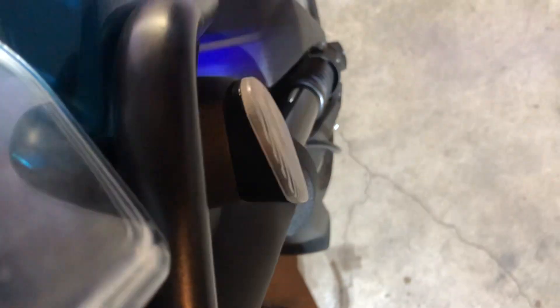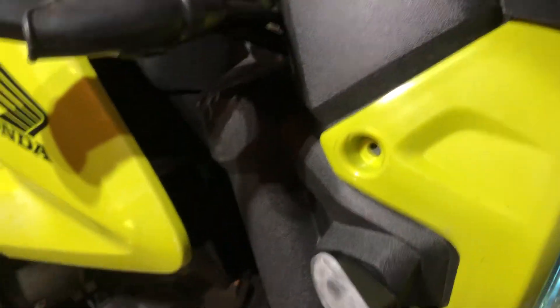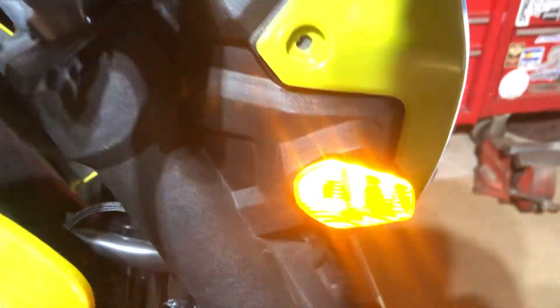I just switched a blue and white wire and a green and yellow wire underneath — you literally just swap those and everything works as it should. On the passenger side, or the right side of the bike, I have the same setup. This other bike has an HID projector headlight and these turn signals are just temporary right now, but again they work just the same.